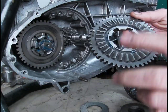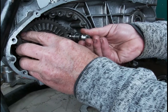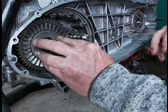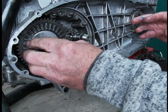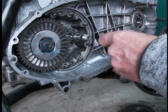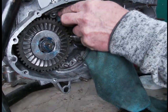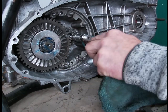And first gear — you can't go wrong because it's got the teeth for the kickstart pinion on there. The shim that we've already shimmed up to the right clearance, we'll put that on with a little blob of grease to help it stay in place. Our end plate — make sure your locating dowels are nice and tight because they locate the position and they're very important. Make sure the face is clean; we don't want any debris on there because that stops it from getting a good tight bolting down — it needs to bolt down to a clean surface.